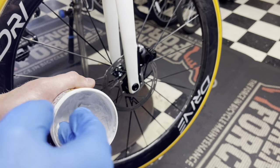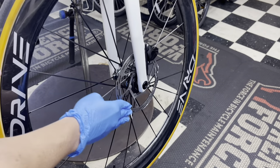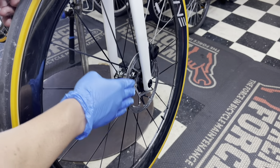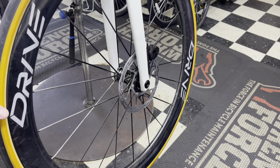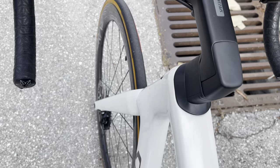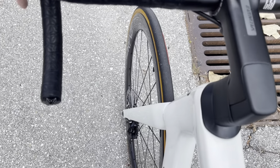I'll take a pretty ample amount of the Squeal Out paste and cake it on the rotors — put it on both sides, a good amount — because after this we're going to go outside and smear it in while holding the brakes to work it into the pads. Do both sides. Be careful if you have a lot of lube on there because you'll end up spreading lube around. When bedding in the brake pads, make sure you have one clean brake pad and rotor in the rear — don't do both at the same time.